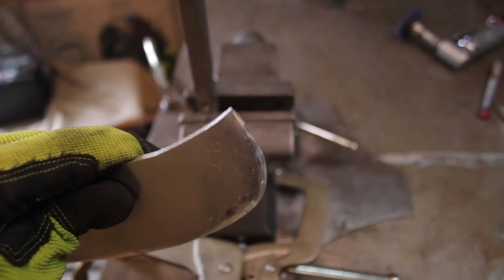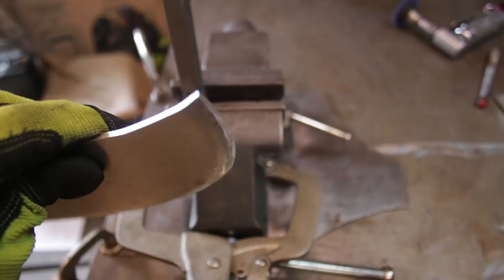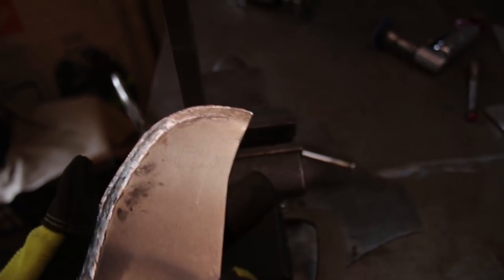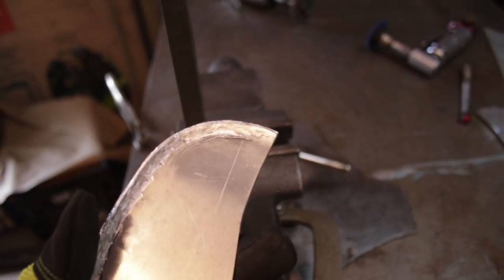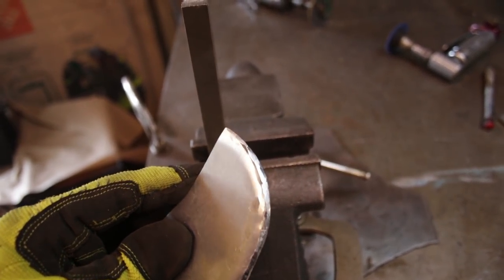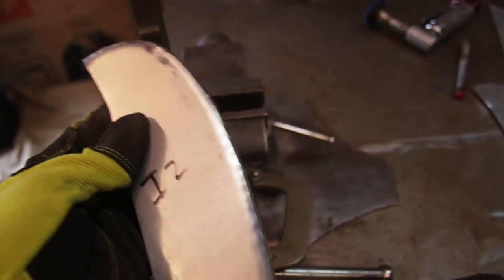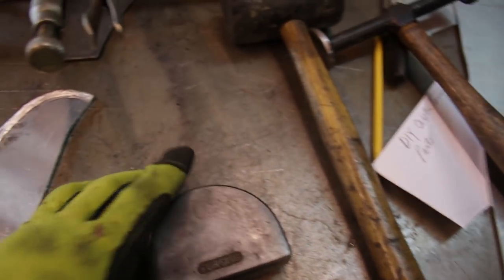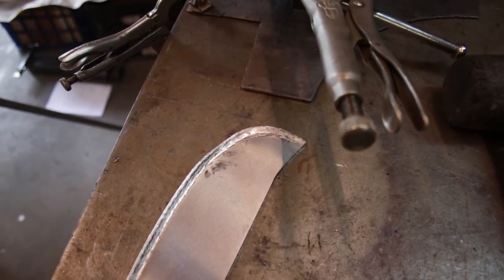This went around the corner a little better than I expected. It's not all the way around but it's about as far as I can do. The difficulty is it's hard to hit it with the hammer when there's nothing on the far side to hit against. So I can only bend it so far. The rest will be done by hammer and dolly. This is the bottom of the bumper - I just got to bend it a little bit more with hammer and dolly. I'm going to look for a dolly that has about the same curvature. I have one that's close but I need something just a little bit tighter.